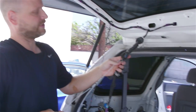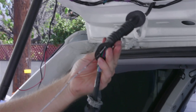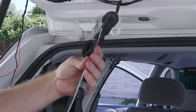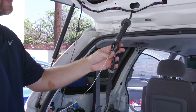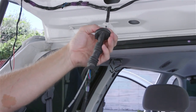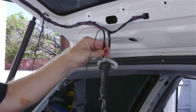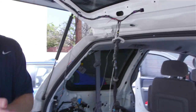So I'm going to run two wires through the loom along with the video cable. In order to run our wires we'll need to fish them — we just use a cheap coat hanger. One thing you should do is massage the wires so that all the wires are on the backside of the grommet, and then bend your fish so it has a little bit of an arc so you don't get tangled with any of the factory wiring. One little trick we use is dishwasher soap to lubricate the cable — it's non-toxic, won't damage the cable, won't harm it in any way, and is super easy to wash off with just water.